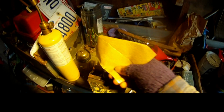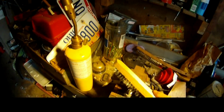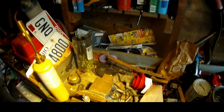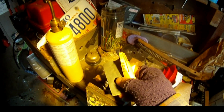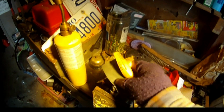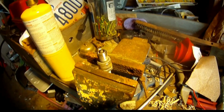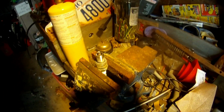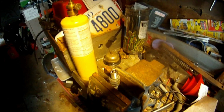And you could use a finer grade of sandpaper if you'd like. I'm actually going to use a couple of them here. Use that. Just kind of hitting the cathode and the anode right there where the spark gap is. And this is 1500 sandpaper. I'm just going to shine it up a bit, really. It makes it all very clean. So, if you remember what it looked like before compared to now, huge difference. Let's go reinstall this sucker. Make sure this thing is now operating properly.